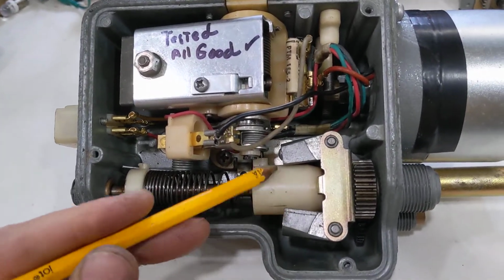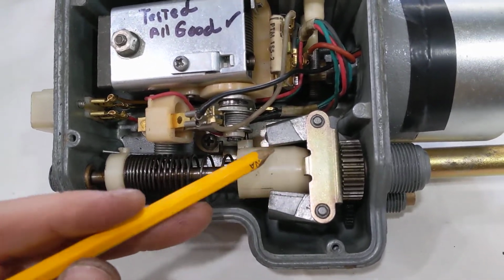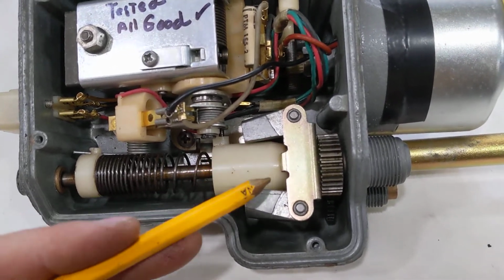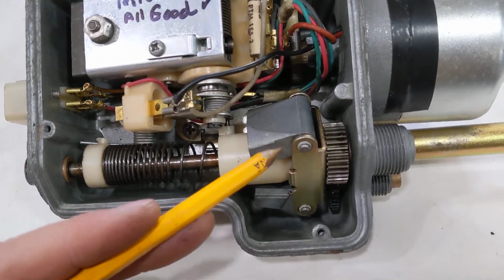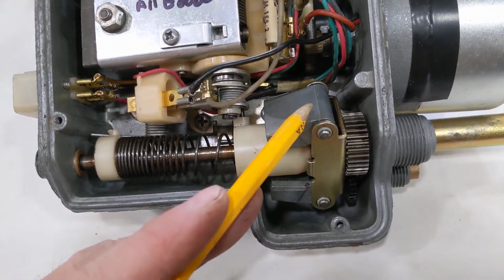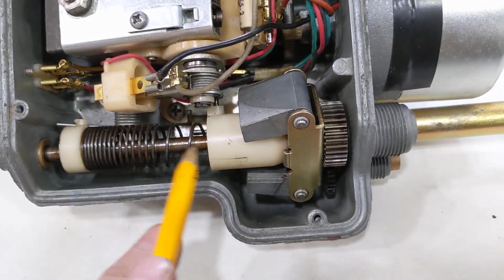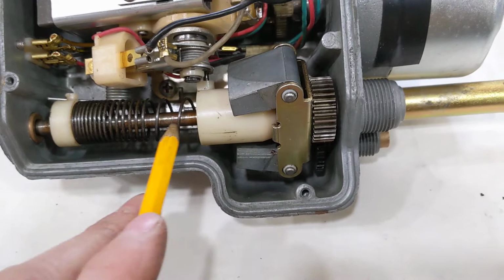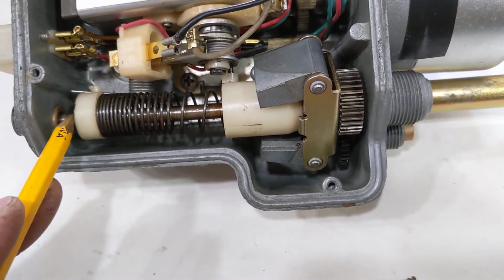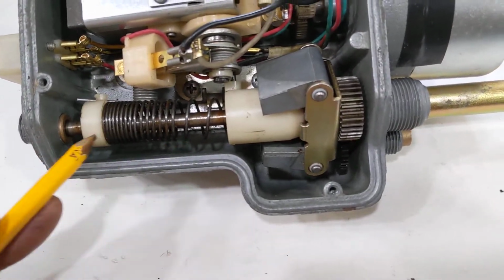This here is the Centrifugal Fly Weights. They're used sort of like a steam engine to control the speed. As this thing spins, and it spins with the speed of the transmission, which represents ground speed, these weights move out. There's a lever arm inside. It moves this. That movement is counter to a coil spring. The coil spring tension is set by the Bowden cable at the end, and that pulls this in and out.